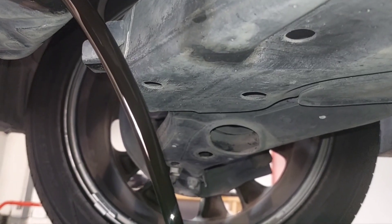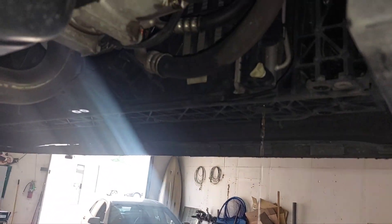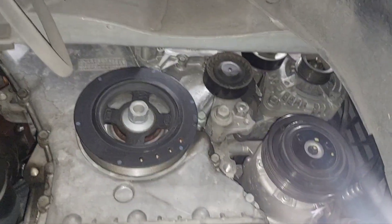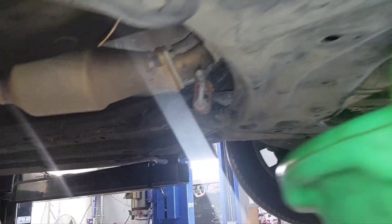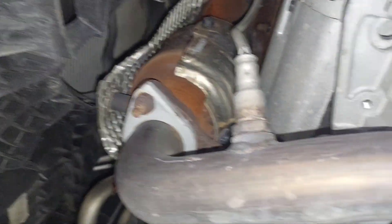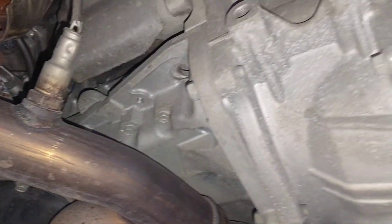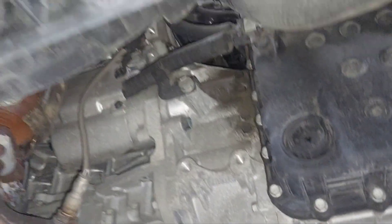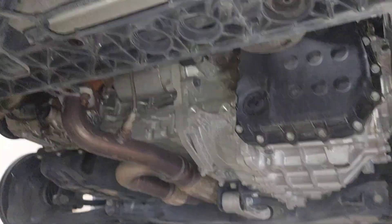They did add a lot of oil right before they shut down. Got it draining, got the coolant plug out, got the belt off. Going to unbolt the compressor and swing it. Looking at the exhaust — I'm going to disconnect it right at the manifold cats. I've got a ton of room down here, so I'll probably take the radiator out and shift it forward, then lift the car off of it.